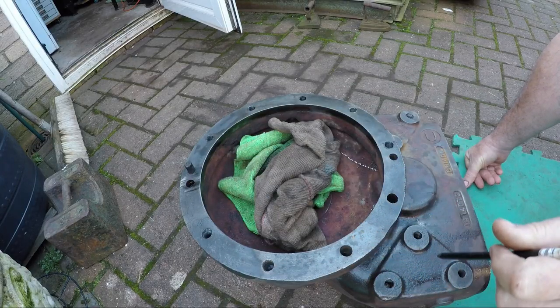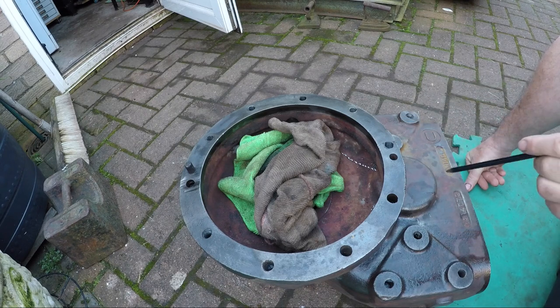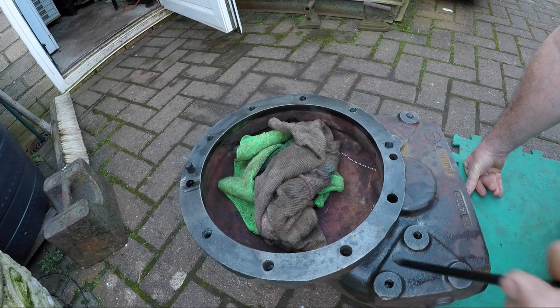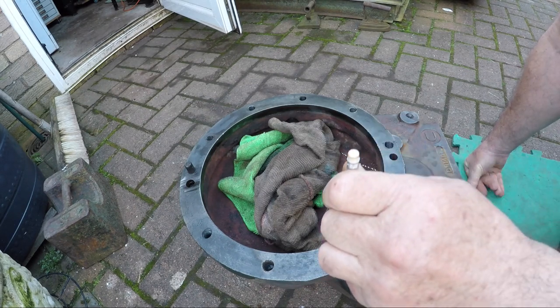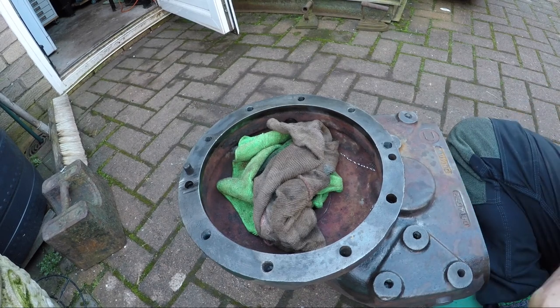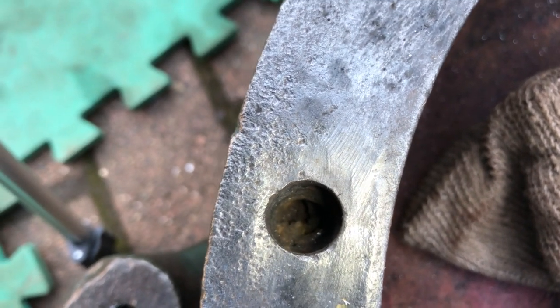As you can see, had a bit of a wire brush and it's come up pretty good. The surface is a bit rough from me messing with it yesterday putting a bit of heat into these holes to get the broken studs out. There's a broken stud in here - this one we've drilled out. We've been through every single one of these with a tap with the exception of this one, because down in the bottom there is another broken stud that someone has tried to drill out and not made a very good job of - hasn't even found the centre of the hole. I've ordered a 13mm slot drill because it can go down there, cut that out, drill it, and helicoil it - a couple of helicoils to repair that thread.